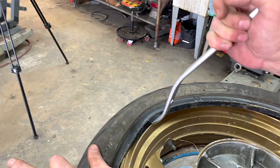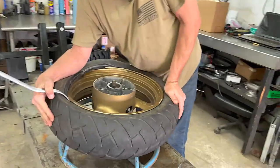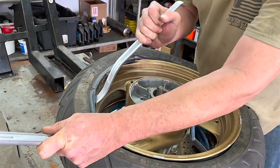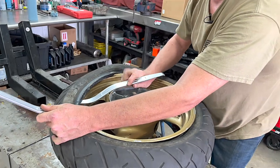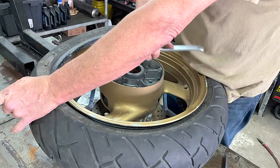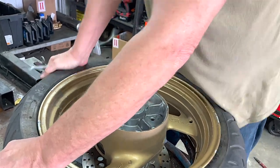You could do this on the floor, but you really do need a secure way to hold the wheel. We have to get it down — that tire's hard. There it goes. And we just continue around. You do not have to take big bites of this, just nice and easy. These are great levers. We just keep going. It's a little bit tighter towards the end. And there we are.